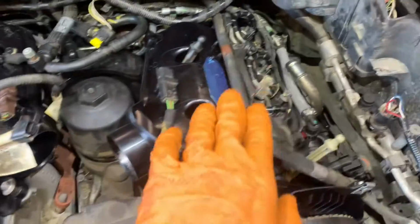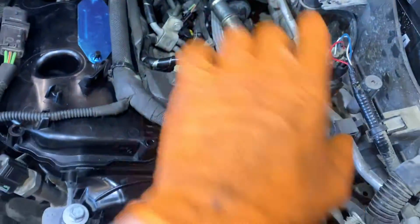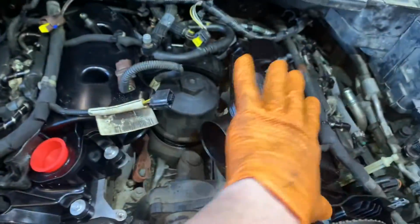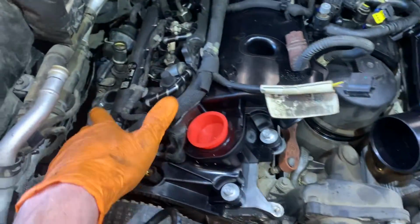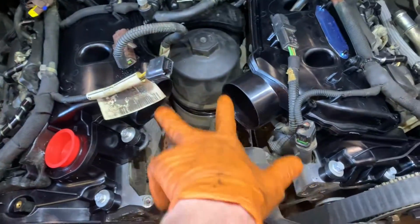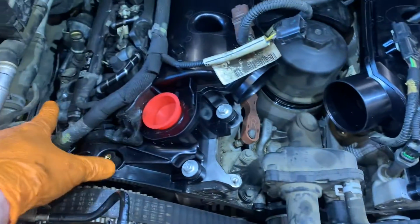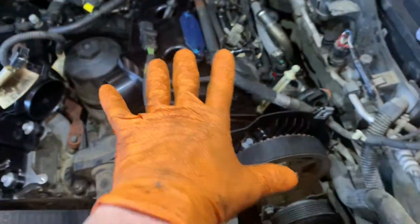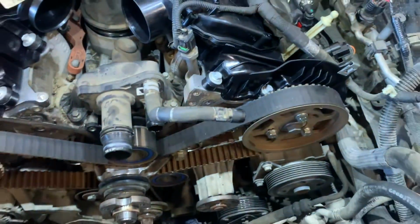Right, so all the fuel injectors are back in, fuel rails, etc. Spill off tubes all around the back. Wiring loom's been folded back over now as well. Both sides. Top. Just got to put the inlet back on. Obviously, the EGRs go down each side. However, I'm not going to do that just yet. As I said, we're doing the belt, so we're going to leave that out of the way.